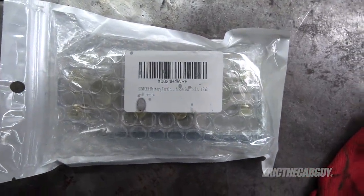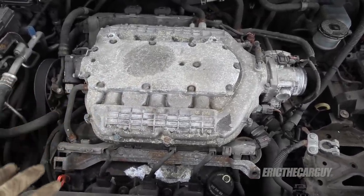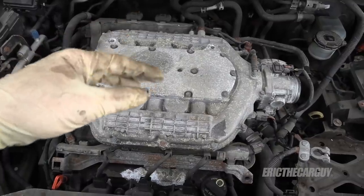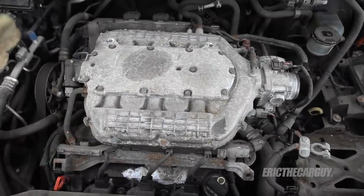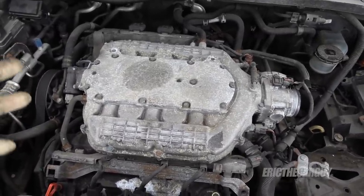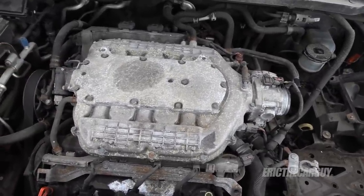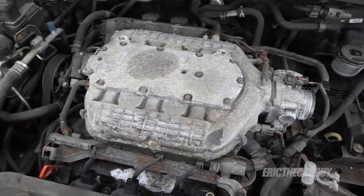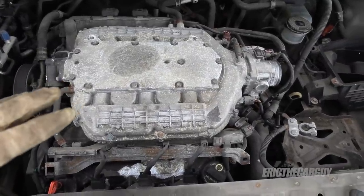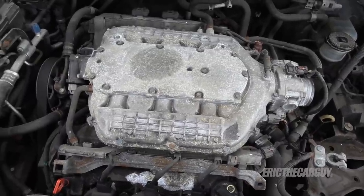I have new battery terminals because I hate the old ones. Before I start installing a bunch of new parts onto this engine, I want to assess its condition. You might remember from a previous episode that the rear catalytic converter had come apart internally and clogged up the exhaust — that didn't happen for no reason. It could have been a misfire, burning oil, or any number of things. My hope is that it was a bad spark plug and lack of maintenance. To be safe, I want to do a compression test, and if needed, a leak-down test.